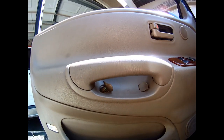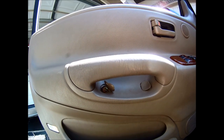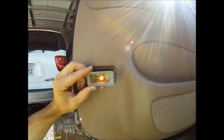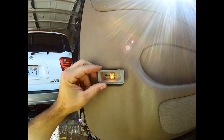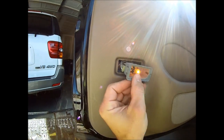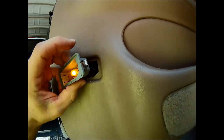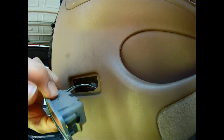I popped off the covers and they're not the standard Phillips. It's the little star head, known as the T30 — that's the right size. So remove those two bolts. To pop this off, the cover came off really easy. This side is just a little hook. This side was a little trickier — I had to push a screwdriver against that and then it came right out.